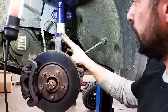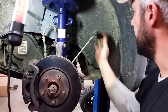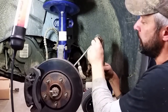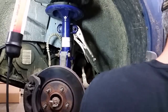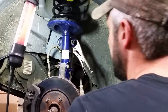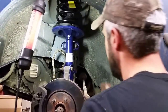Now that you've got your two lower strut bolts tight, we're going to go ahead and reinstall the sway bar link. This customer is looking to save a little bit of money so they don't want to replace it. We're going to pretty much just put it on just like we took it off. Clamp your vice grips right on the metal flat on the inside of that sway bar link. Line it up in the hole, take your nut, spray a little panther pee, put a little never-seize on there, and use an 18 millimeter socket to run that back on until it's tight. And that's simple as that.